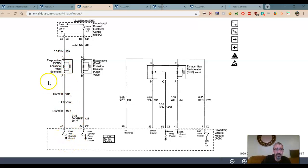We can operate this, close it off or open it, and we now can open and close the vapor pathway from the gas tank. Over here we have our canister purge control valve. Same fuse. We control this, and we can look to see if vapor starts entering the engine, how it runs. Or maybe we could shut it off and discover that that thing's stuck open or something along those lines, right?